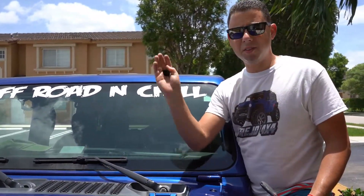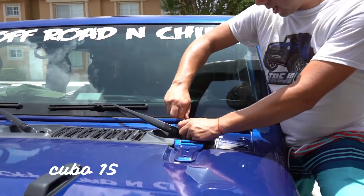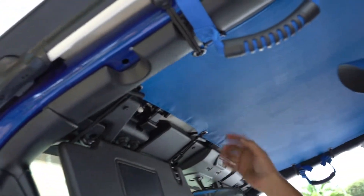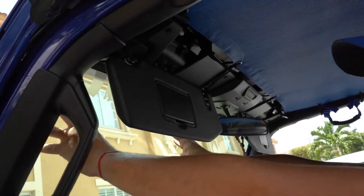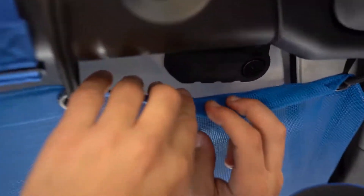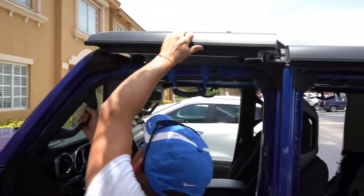Alright my people, to fold down the windshield, we're going to be removing these little plastic pieces. To remove the wiper, we'll be using a 15mm socket and remove the wiper blade. Moving forward, we're going to remove the front roof section up here — remember, the latch on the right side is what holds the windshield. So now, if you notice, the roof won't come out yet — we have to remove the two front roof covers first. Look here at how it disassembles. Both sides, the same operation.